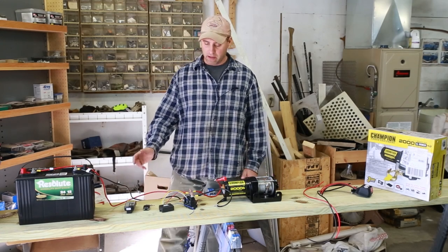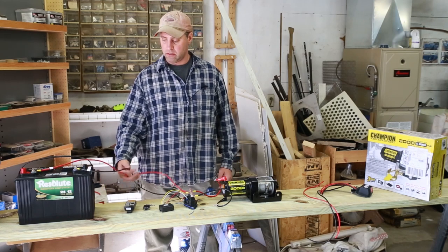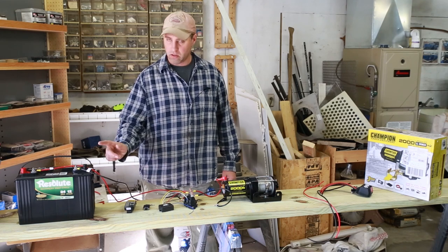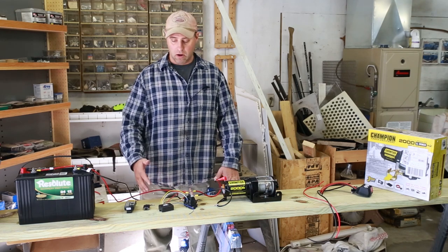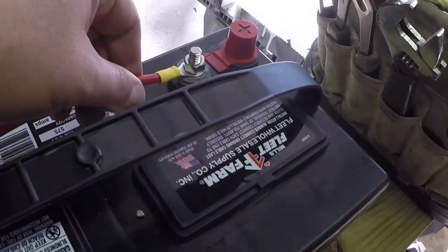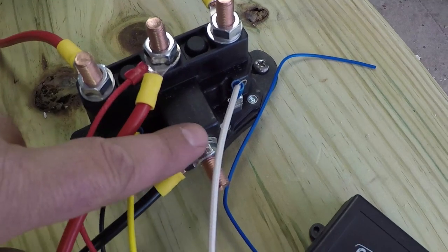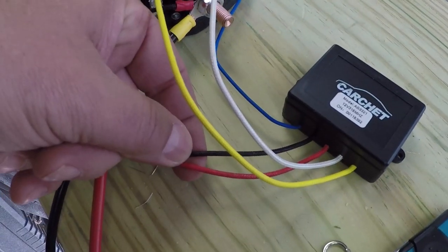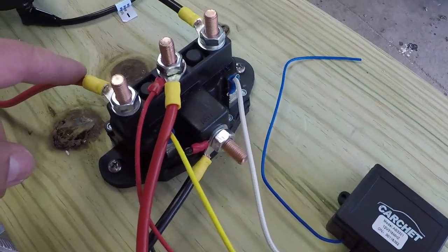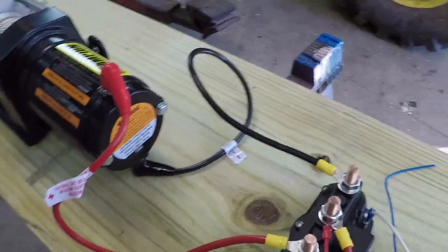Alright, I'm not really sure what happened there — had some sparks flying off that. I don't know if it was the order I hooked it up, but both of these wires here got really hot so we had to have shorted it out somewhere. All I did is unhook it from the battery, make all the connections, and now it works just fine. So to show you what I got: we got the cables coming off the battery — they go down to these two center posts, this one here and this one here — along with the red and black off the wireless controller. And then the other two posts here and here just go to the winch.